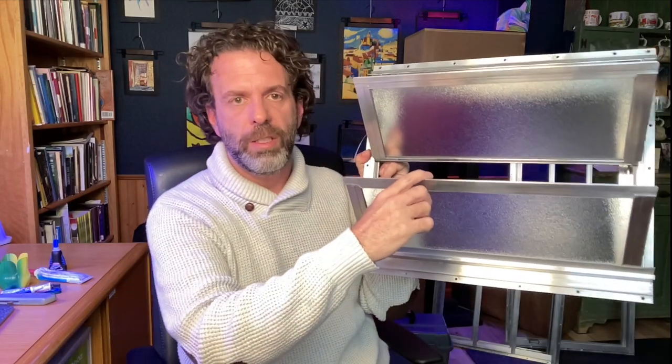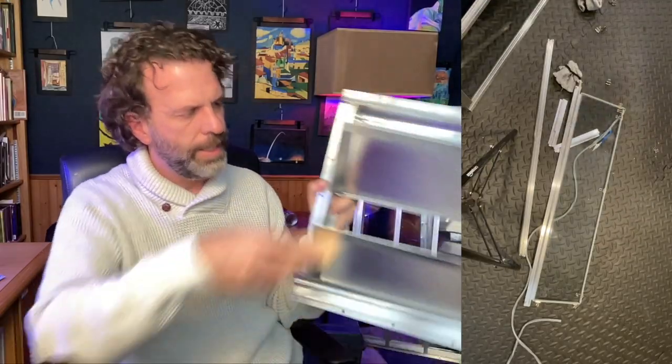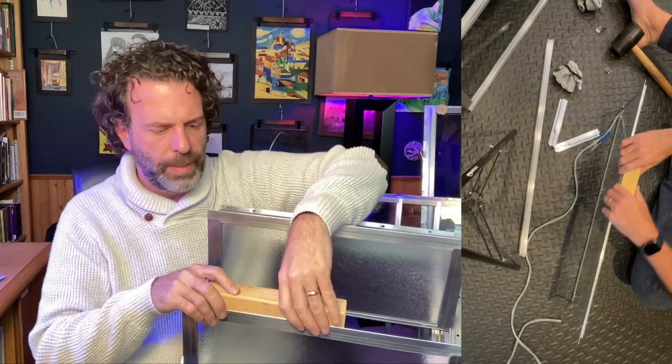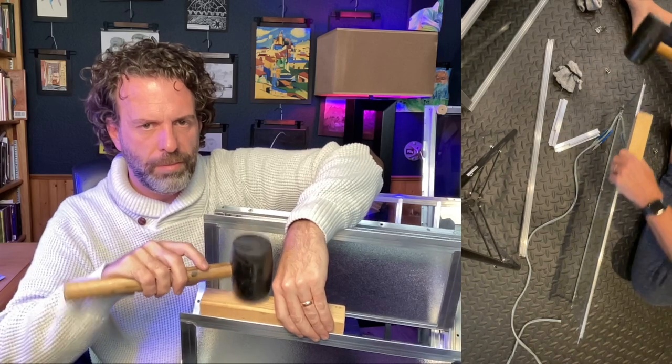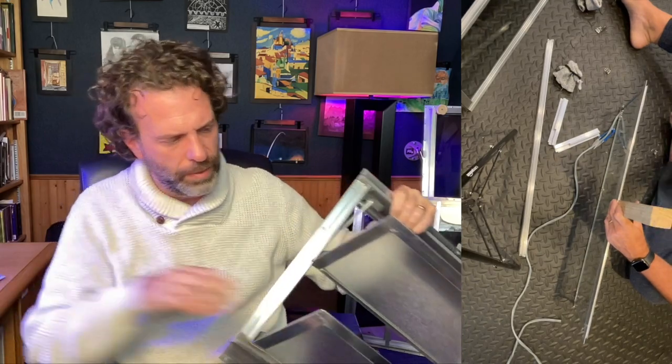I used both. My other two tools, and don't get after me, I'm not responsible for any breakage. I've broken three windows, by the way, not with these, but there were times where it was hard to get the edge on some of these windows with the seal in place, because like I told you already, of the thickness of the windows and the thickness of the glazing. What I did is I would put this just like that, a little block of wood, and just kind of tap to get that metal bracing to go over the seal and over the window.